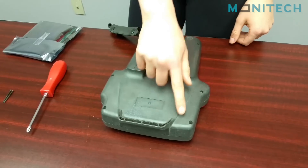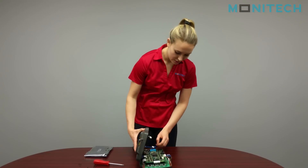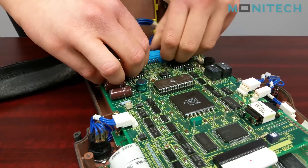You can start off by taking out the first seven screws on the back. When you take the back off, just unplug the cables that are going into the front board — unplug this, and unplug that, and then you can unplug this as well.